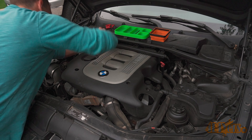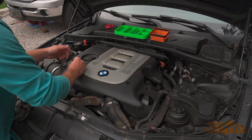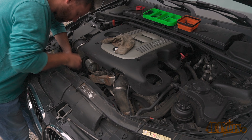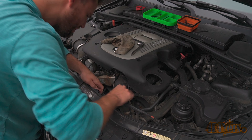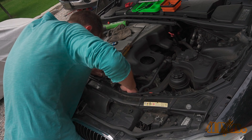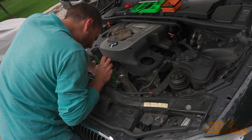The AC, power steering, alternator, and water pump are all driven by the belts. If the pulley doesn't rotate, the first error that will pop up in your gauge cluster is a charging-related light. You may also feel excessive vibrations while the engine is running.